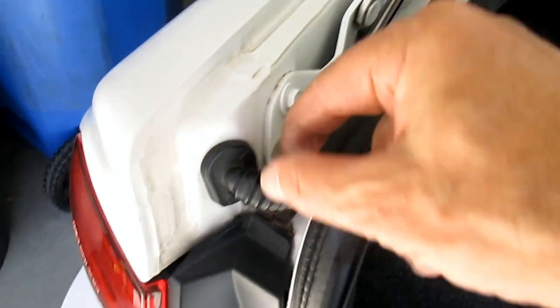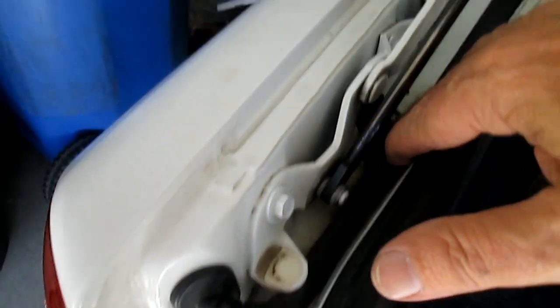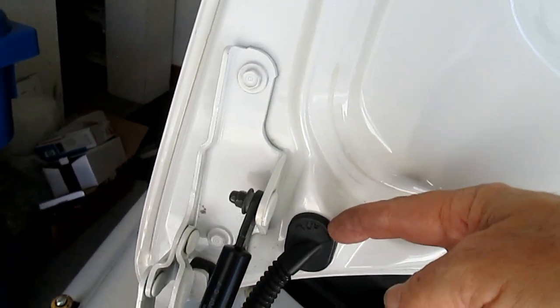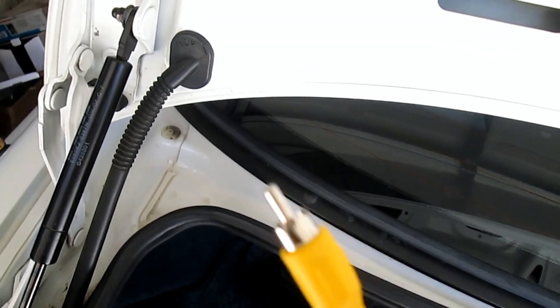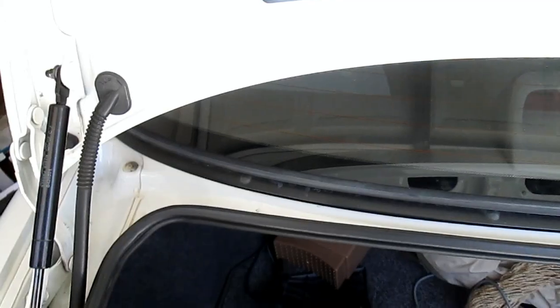Manufacturers have a clean installation that goes from your car's electrical system back into your trunk — things like the license plate light illumination and that ABS sensor we mentioned. It's a very small connector, and the video wires to the camera are much thicker than that — I can't get these wires through that little connector. So we're going to have to come up with a different way to install and connect it. It's not the perfect solution, but it'll work.